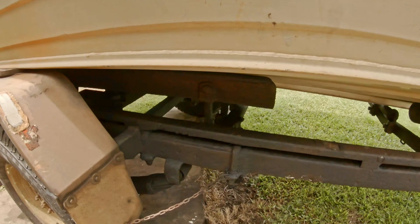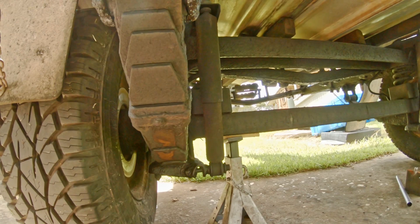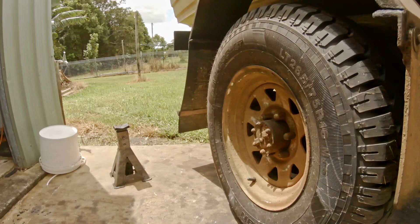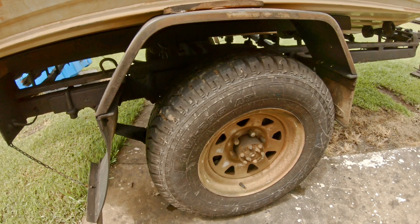I've jacked that up and put a stand under it. Because they're V-shaped I put a little thin bit of timber in there and it just sits on the flap underneath better. Safety tip: if you haven't done this before, before you jack your wheel up you loosen your nuts on the ground first - don't unwind them right off, just loosen them off a bit.